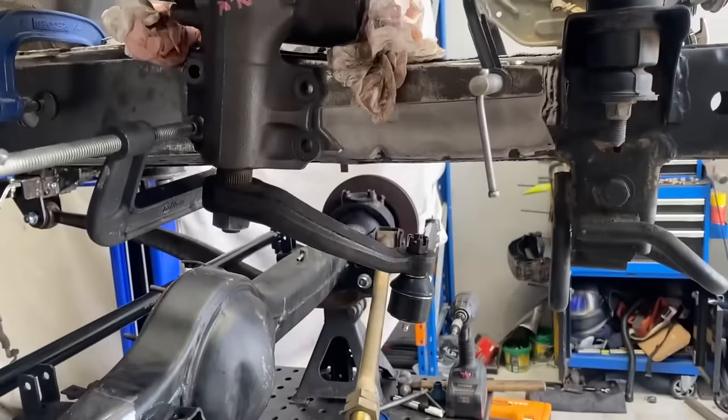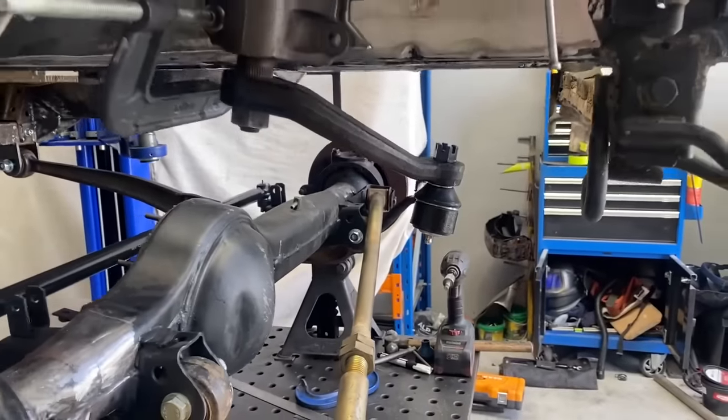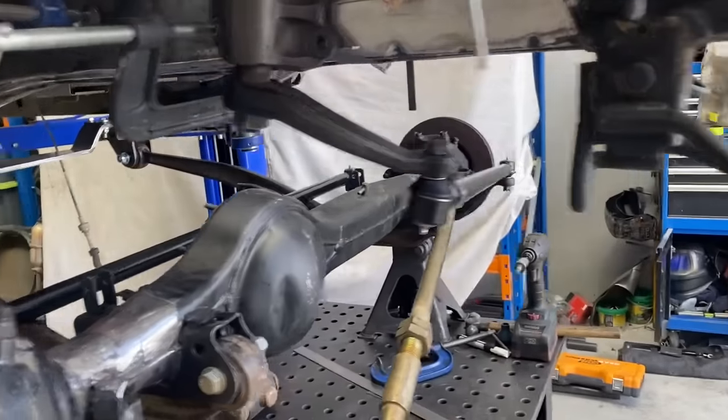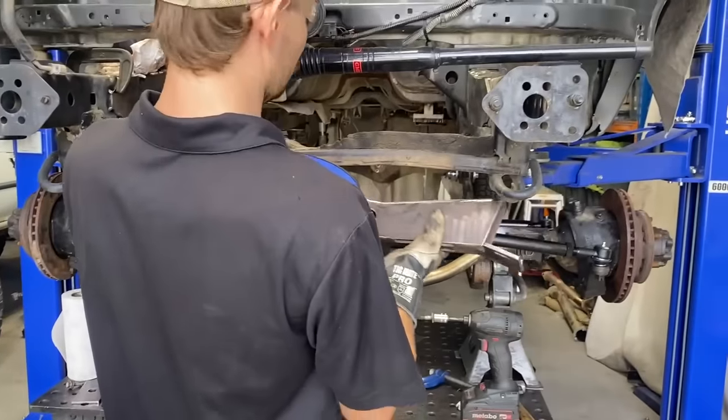So we're just trying to fix that up now by adjusting the steering box and the subframe mount. And we're just trying to sort of bring all that a bit closer in and more dialed in to where we want it. So Brendo's just shaved off some sides, and now we're gonna do another retest fit.